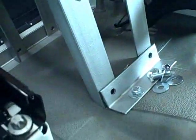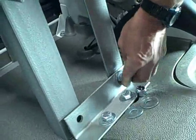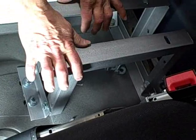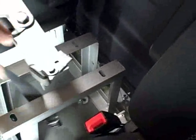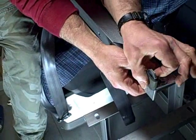Now it's time for the upper brackets. The upper brackets slide right in between the front and the rear bracket — just like that — and then you're going to put your half-inch hardware through it, then put another washer on the back side. The same goes for the other three locations, front and back. Now that we've put the upper brackets in with the nuts and bolts, they're not fully tightened down yet; there's still a little movement left in them because you may need that to line the seat belt bar up. The seat belt bar has the seat belt pre-attached with the bracket, allowing the seat belt fabric to go forward. We pre-assembled the pedestal tabs — these are going to rest against the back of the pedestal; there's a little rubber protector on each one. These get nuts and bolts in these holes, and we're going to snug these brackets up against the back of the seat pedestal.